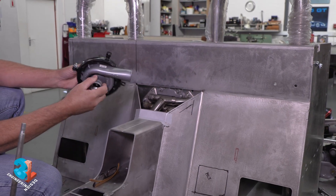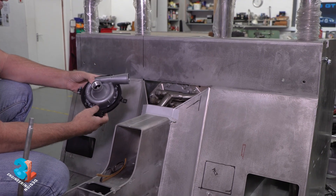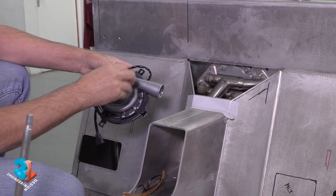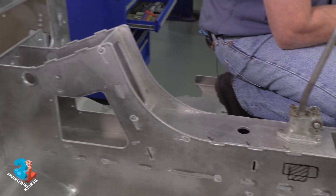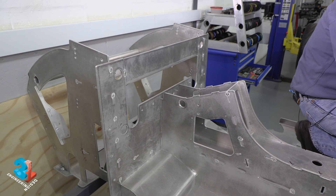We're going to be driving it using an electric water pump. This electric water pump will be sitting inside the engine bay. The water that leaves the engine enters the pump, gets pushed out through the tunnel to the radiator where it starts to cool down, then comes back up in the engine bay and back into the engine.